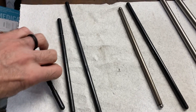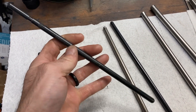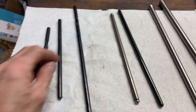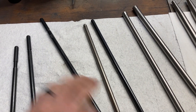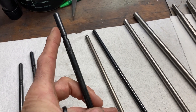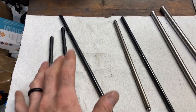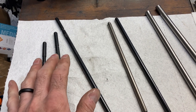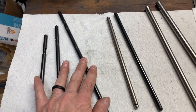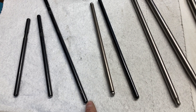That's why they make push rod length checkers. I have probably 10 or 12 of these in different lengths. I have some with a cup end for FE stock rocker arm stuff, some with a 5/16 ball on one end and a 3/8 ball on the other so I can use a modern lifter and a factory non-adjustable rocker arm, and some with a 3/8 ball on each end. Whatever situation you're working on — whatever lifter, whatever rocker arm — I'd suggest buying a length checker for that specific application. It's very critical that you match the ball diameter.